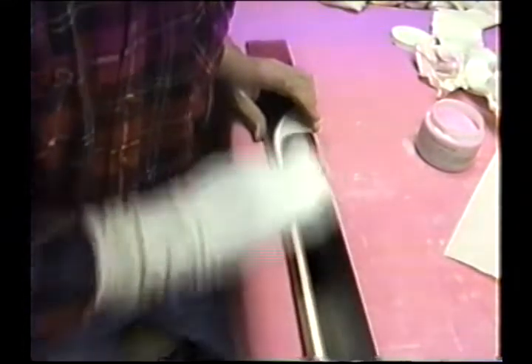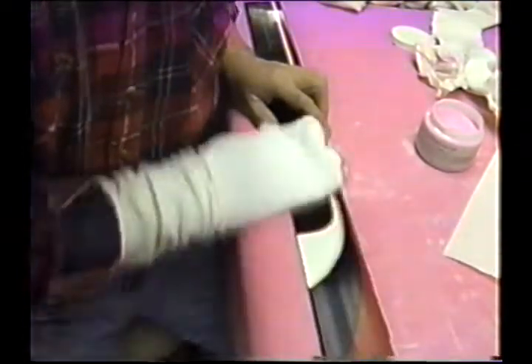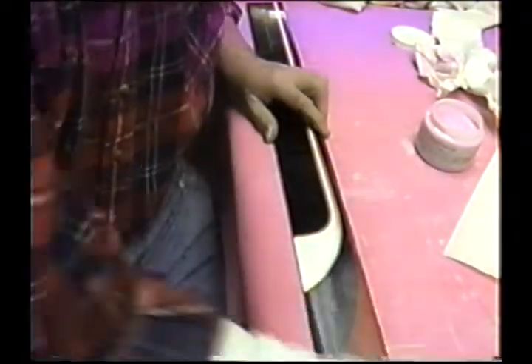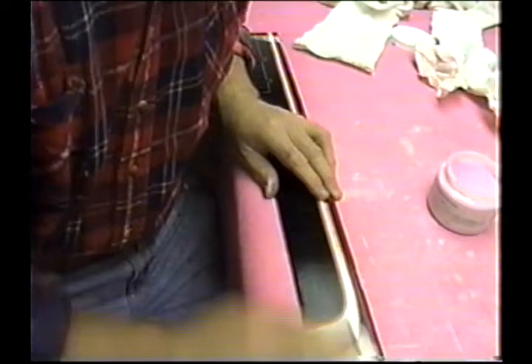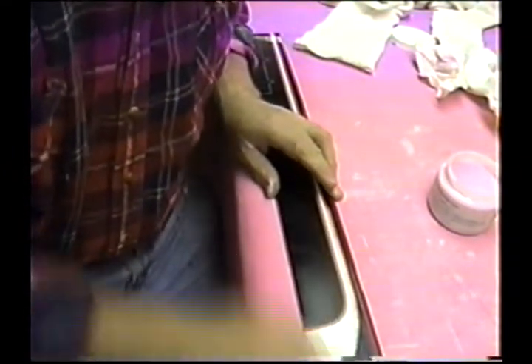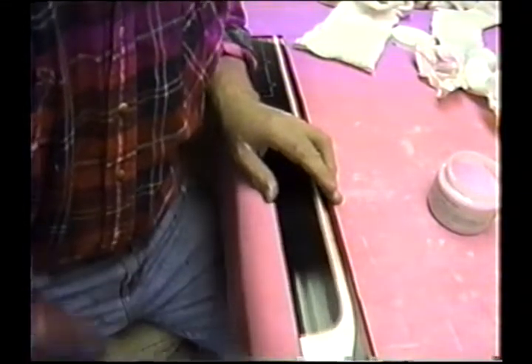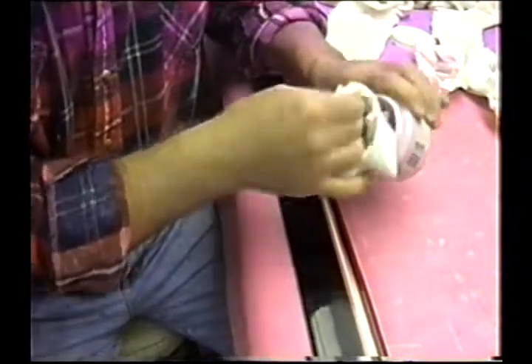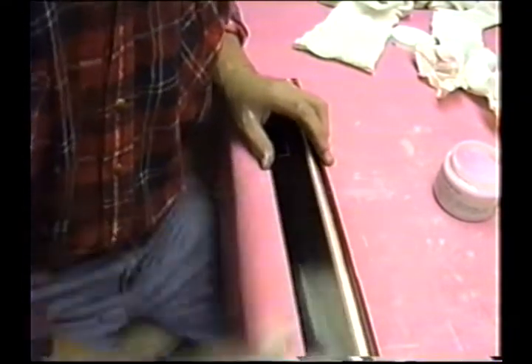Any part of the plane that's flat like this — relatively easy, relatively quick. Get all the compound off, then get a clean paper towel. The flat parts go relatively quickly. I've tried using various Imron-type products — yeah, they leave a shine, but the shine is not as dramatic or as classic as a buffed out lacquered dope finish. They're always a little heavier too. I've never seen anything two-part that's lighter than dope.